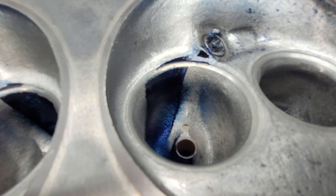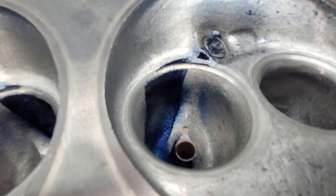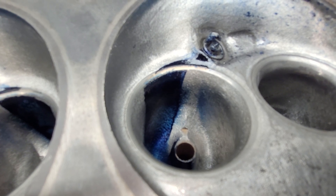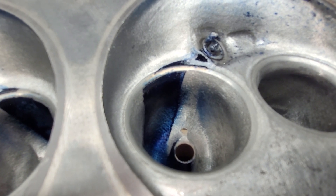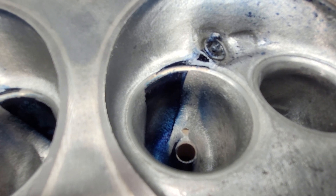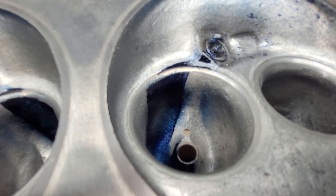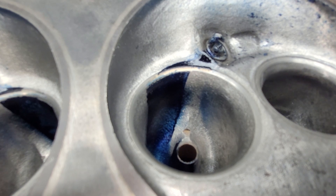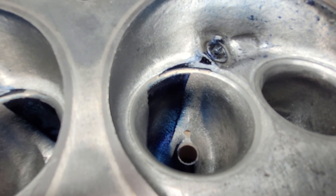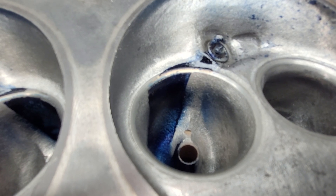As far as getting our horsepower requirements through the tiny dual plane — these are only down a few CFM, and I mean few, like 10 or 12, versus the port that flows 20-plus more. That's interesting — not what I would have expected. The restriction is the restriction; you can't get past your main major point of restriction that easily. So in reality, when we have it strangled with the two-barrel and that dual plane, these may make better torque in the mid-range, but they may top out almost the same as the bigger port did.